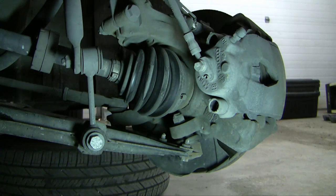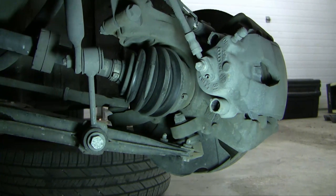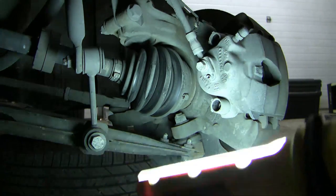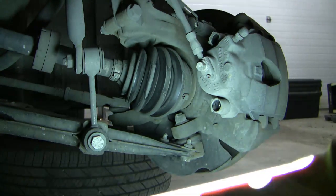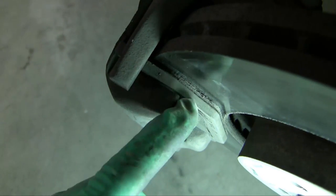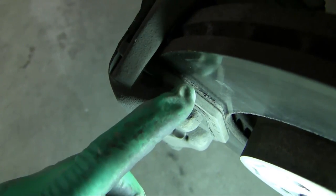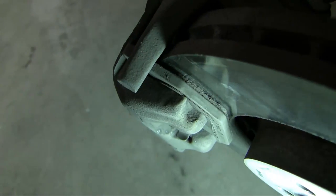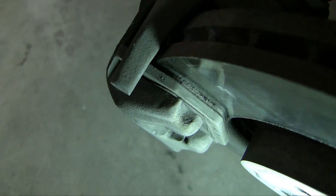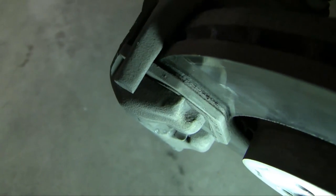While you're at it here, it's worthwhile having a look around. The boot looks to be okay in the steering knuckle. Shock absorber — there are no leaks on these newer cars, and we don't have any grease nipples. The ball joints look to be okay. Coming around to the outer aspect, here's the rotor and here's the brake pad. You can see that little narrow gap there is the remaining pad — it was clearly time to be changed. That's about two millimeters.